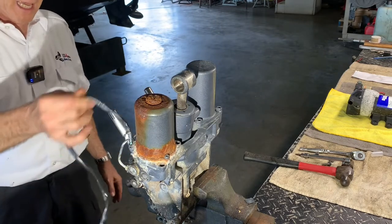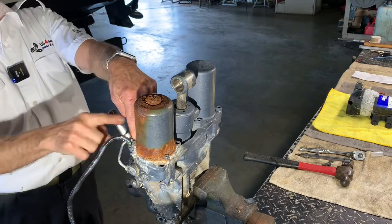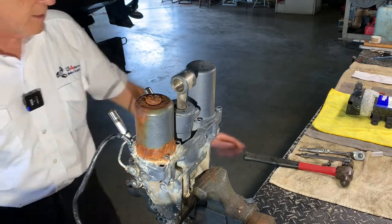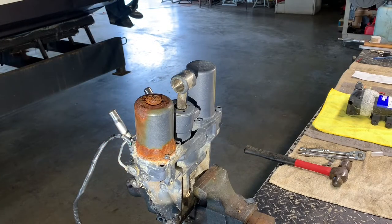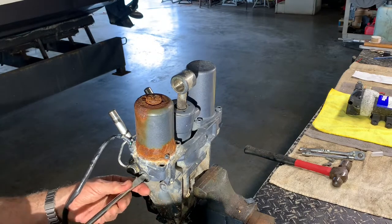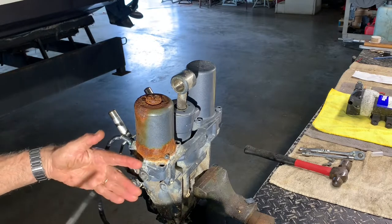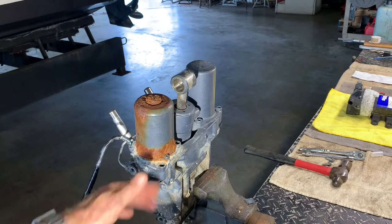I notice that my cable was on the right-hand side on the front bolt. So I'm gonna put the new motor with the cable right here, same way. So now, before you do that, I almost forget. Before you do that, remember to loosen your manual release, because then oil will be all over the place. See, right here. This is the same manual release, but before you were looking at it through the bracket of the engine. Now it's just an open feel, okay?